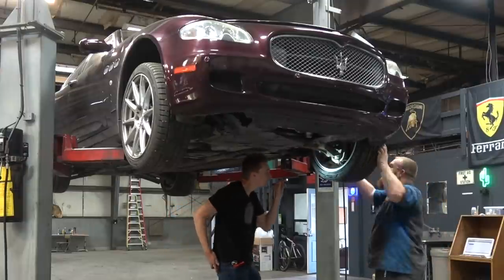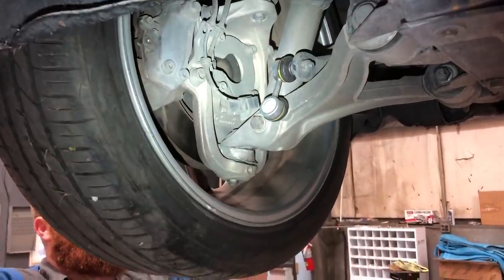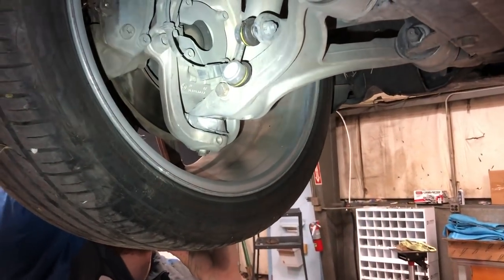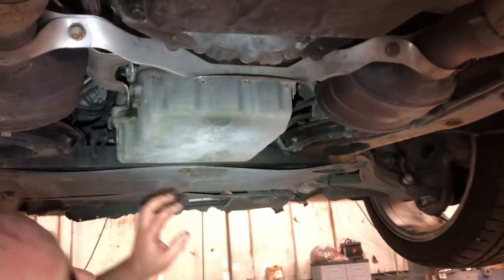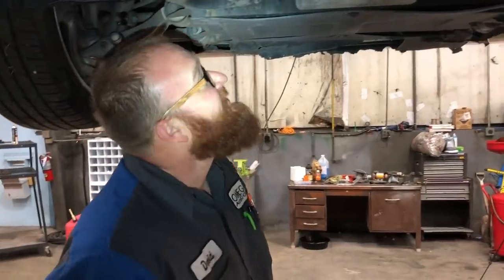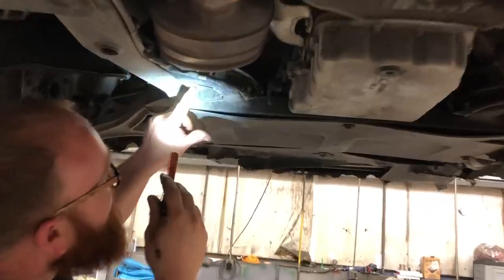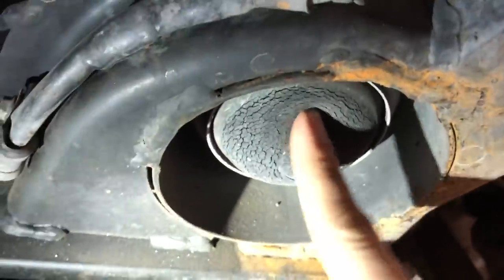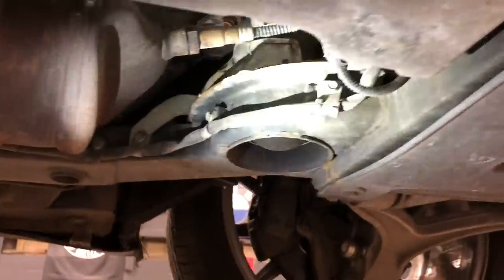Let's check the other side — probably the same. Uh-oh. Tie rod in. That's not good. And it has the same up and down play. There's your clunky noise. At least the engine looks nice and very, very dry. Exceptionally dry. Hmm, there's the motor mount — what the hell? It feels like a pimple that really needs to pop. I think your motor mounts are junk. I've never seen one where the rubber is underneath like that to where you can just poke it like the Pillsbury Doughboy. So that's probably my culprit there. Yes, you have bad motor mounts.